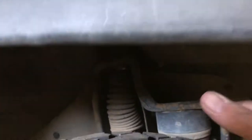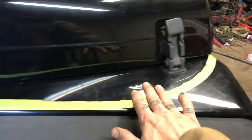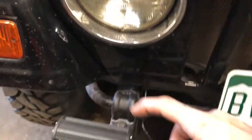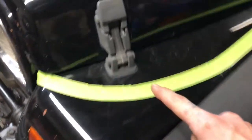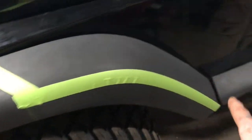That way, a lot of guys I see that cut their fenders end up with these guys sticking down, and I don't want to hit those on the tires, so I'll leave the first one there, and then the flap will start here, the fender will be here, this will all be gone. I've got some round jammers for there to replace that, and then I've transferred it to the other side using a tape measure, making sure I've got the same distance here and here, etc.